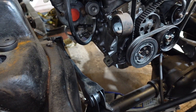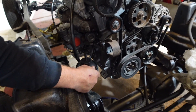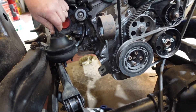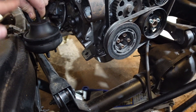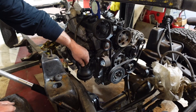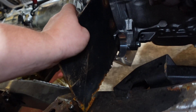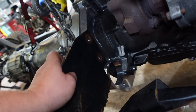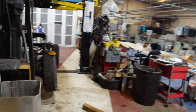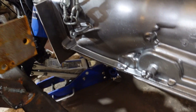Here's the passenger side — plenty of room on this side. This is where we're going to make our motor mount from, which was originally on there from the stock front-wheel-drive setup. This is our other issue with it coming up and hitting that, so I'm going to have to raise it up or figure that passenger side articulation out. We just want to get this thing tacked roughly into place so we can take the forklift off and lower the body down. We got this piece of scrap which is perfect — it already has a hole in it. We're going to weld it there, bolt it there, and that side will be done. On the driver's side, we have that plate — we'll just make a piece of steel go from there and tack it up.